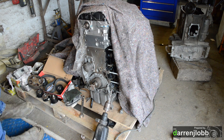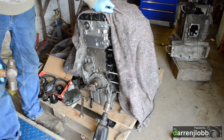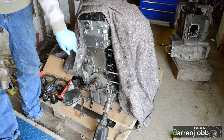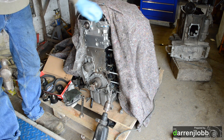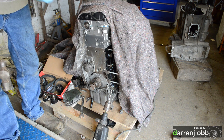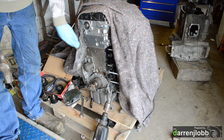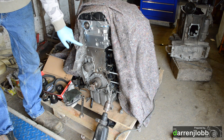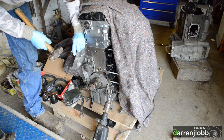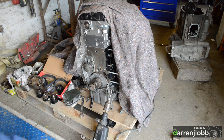The way we're going about this - it's not really how I would like to be doing it, but now that I've gone this far and put it together we're going to have to work with what we've got. What you really want here is to have this in a mill or at least in a pillar drill where you've got it square and can measure it and be absolutely sure you're coming in completely square. But we haven't got that luxury and I'm pretty confident with care we can come in square enough. The tensioner sits flush with the block, so if we're just a few thou either side the bolt will still pull in tight. I've marked the hole with a sharpie, I'll put a centre punch on that now just to get it marked, then come in with the drill keeping it square both ways to the right depth, then go in with the tap.